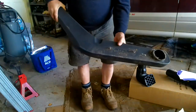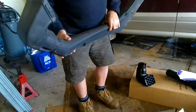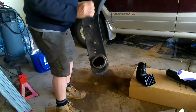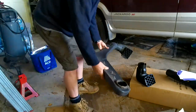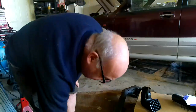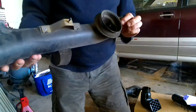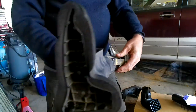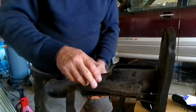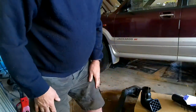Let's look at the problems with snorkels. Here is the snorkel I had on the car - it's a similar snorkel to the Safari snorkel. This side part fits fine - that's pretty standard for both the petrol and diesel. Now this is the original air intake for your car - it goes into the resonator in the air box and sits in the inner wing. You can see that if you were to cover that with water, it's going to fill up pretty quick and you're going to get a lot of water in there - that's one reason why we use the snorkel.